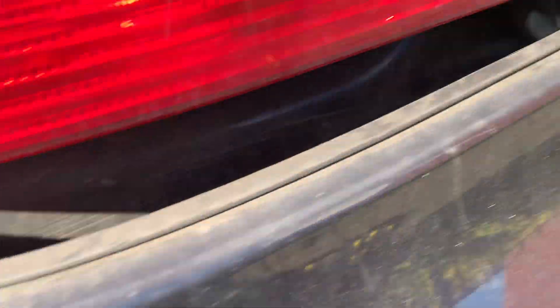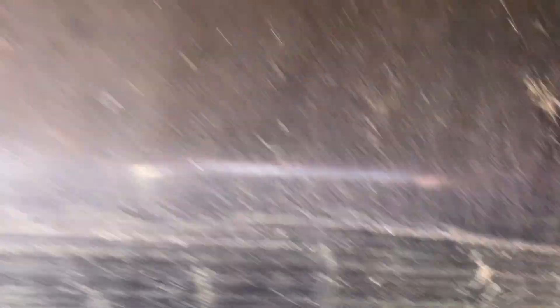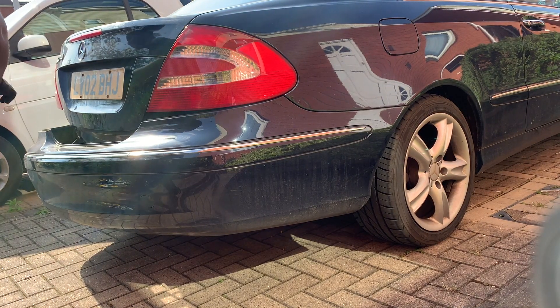Just need to make sure there's nothing else holding it. It's not coming off yet — let me do a check to see if I haven't taken off the wrong bolts. One of those looks like it was for the crash bar, so I need to place them back on. Those big ones — I don't think you need to take those out, keep them back on. They hold onto the crash bar from the back.